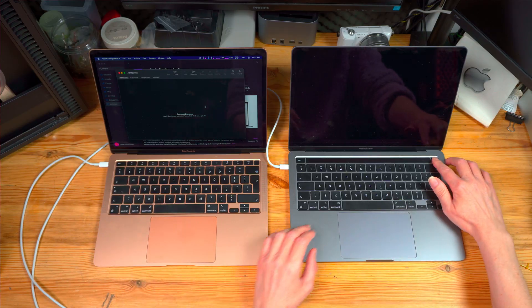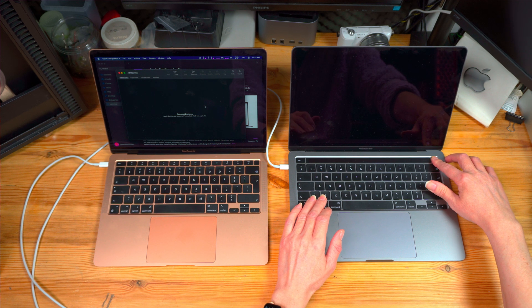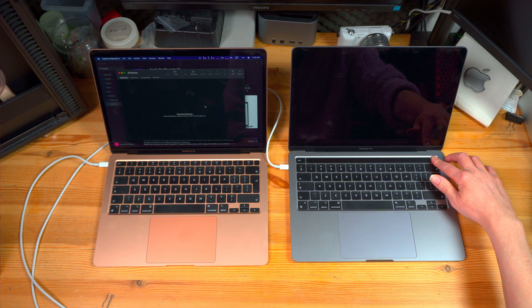Press the start button and keep it pressed. After about a second, also press the left CTRL and left OPT key, and at the same time press the right SHIFT key. Keep holding all these keys together for about 10 seconds. Then release all keys, but keep pressing only the power button until you see on the healthy MacBook display the DFU rectangle.